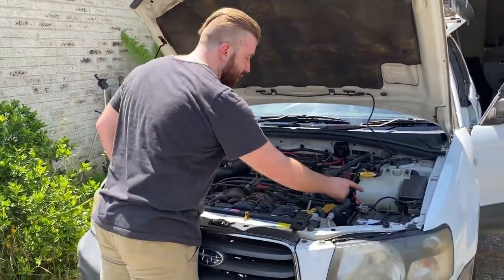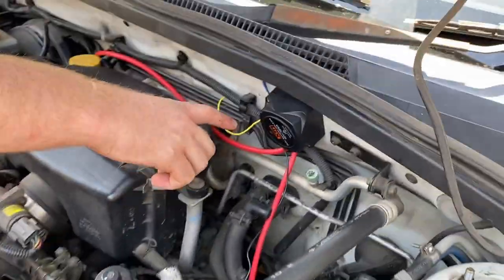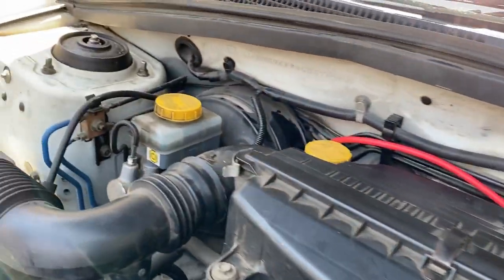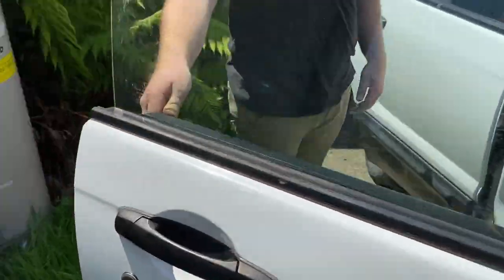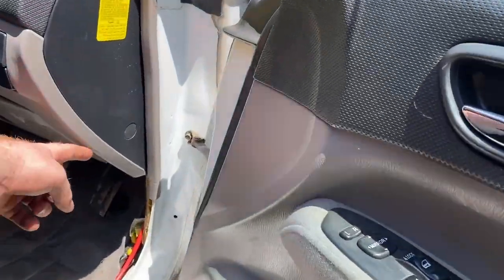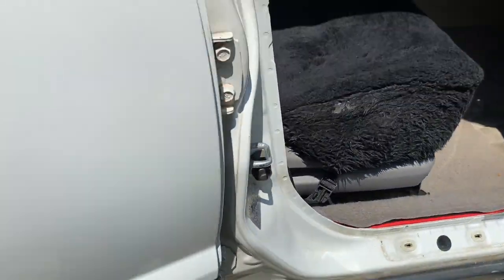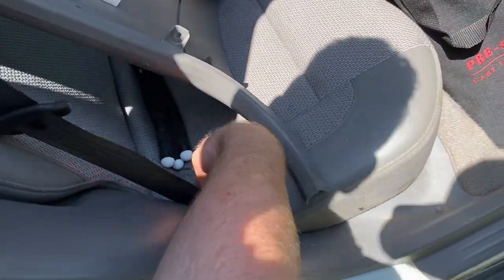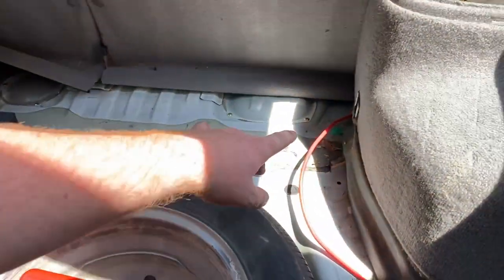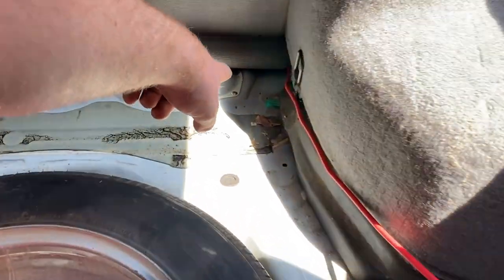So we're running from the battery, got our fuse, the voltage sensitive relay is now set up but not plugged in so it's not live. Running through here and down to the firewall. Coming around this side you'll see we've come through the firewall, down the side here, put it under the trim - we haven't put the trim back on yet - come through here and down next to the seat, through behind there. We've ripped the styrofoam out and it's going to come out along this section here. We'll ground the black wire to the back and have the ground and positive wire coming right out there.